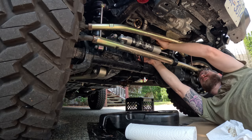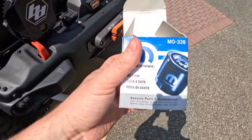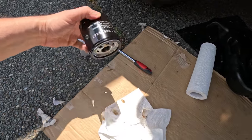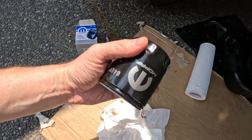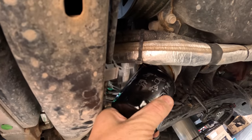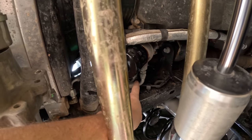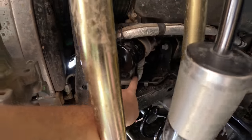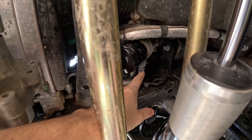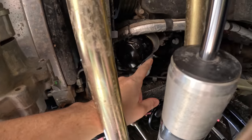The Ginger tells me that the oil filter is the same for the Hellcat motor or the Demon motor as a 2-liter turbo Jeep engine — who would have thought. If you're wondering what this hose is coming off the oil filter connection, it's an oil filter bypass that extracts the oil out of the engine and runs it through a cooler to help keep the supercharged Hemi cool.